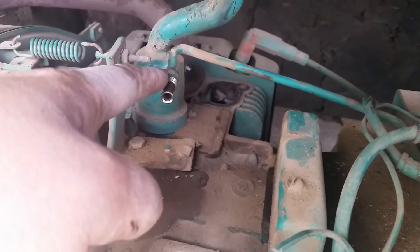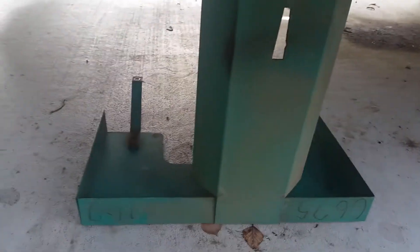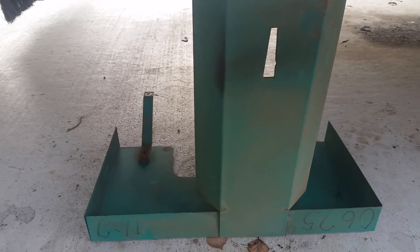That's the electric sender for the electric choke. You can unclip this clip — it just swings down, that's all it does — swings down out of the way, and then you slide the bar out. I just keep the clip on there so I don't lose it. That'll swing out of the way. Undo the fuel line and then four bolts — four half-inch bolts. Two of those half-inch bolts hold that cover on, and you may or may not have another bolt where that slot is in the sheet metal. Mine wore out years ago so it just sits there and rattles.